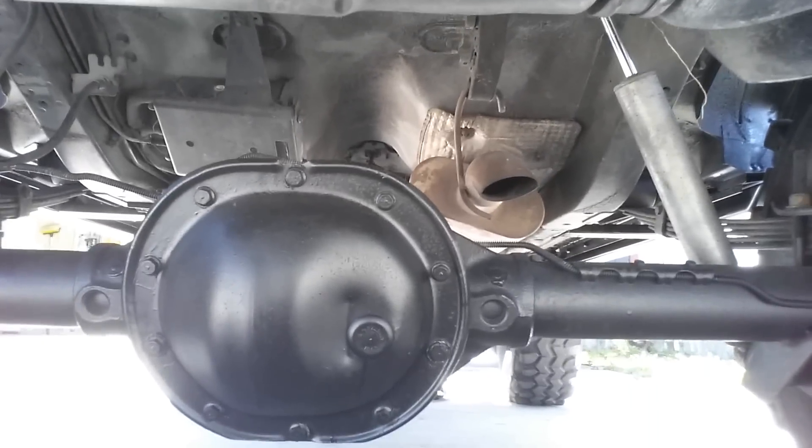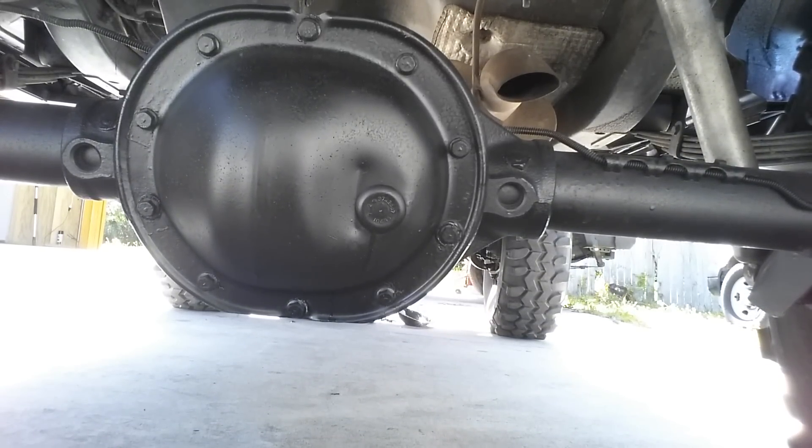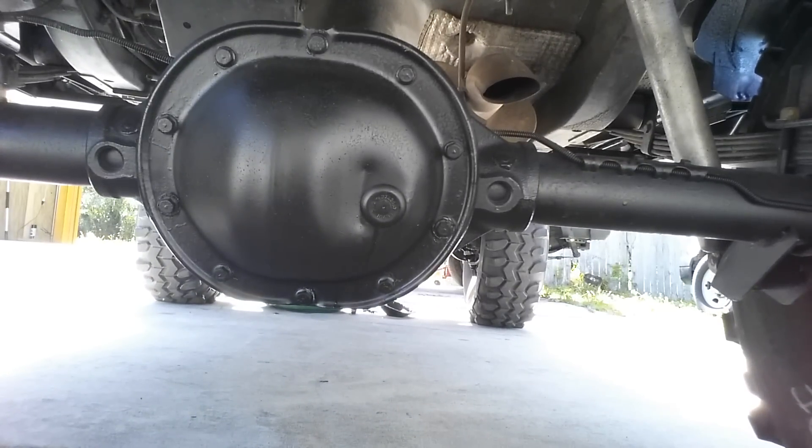Look at that drive shaft - I ain't hiding anything, you guys. I don't know everything, but it looks like to me, with that long arm cross member, it's got the whole transfer case kicked to one side - and that would be why my linkage should come out. I'll have to pull that cross member down or at least lift the transfer case up and see what's going on. I think I broke that transmission mount. I looked at it and it didn't look broken, but that don't mean anything. I was giving it hell last time I had it out in some bad clay holes.